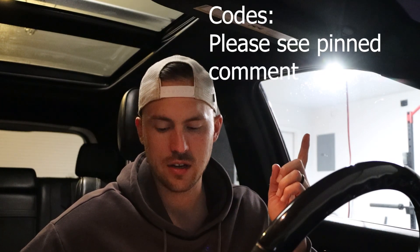The issues and warnings: I've experienced no overall issues — no no-start or running issues, and it never left me stranded on the road, thankfully. The battery light was inconsistent at first, then became more consistent, now happening on starts about 90% of the time. There's a 10% chance it dips to 12 volts and kicks on the battery light while driving. No check engine light showed up, but when my mechanic rolled some codes, he did find some — I'll put those codes up on screen.